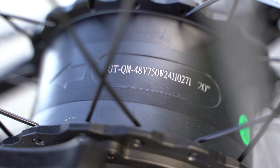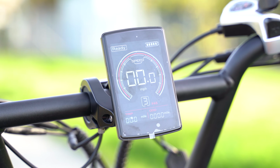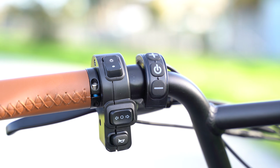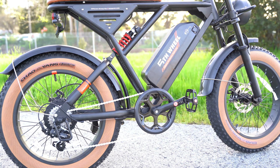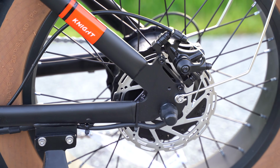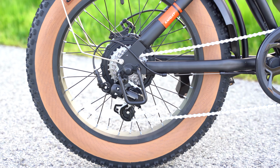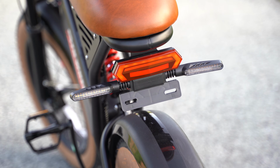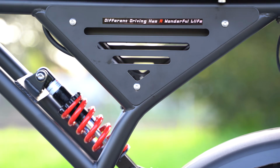e-bike. The Knight has a 750 watt rear hub motor with a max speed of 28 miles per hour or 45 kilometers per hour, twist throttle, 48 volt, 15.6 amp hour battery with a range of up to 65 miles or 105 kilometers, front and rear disc brakes, 20 by 4 inch fat tires, 7-speed Shimano rear derailleur, headlight, taillight, turn signals, and front and rear suspension. Additional specs can be found in the description section below.